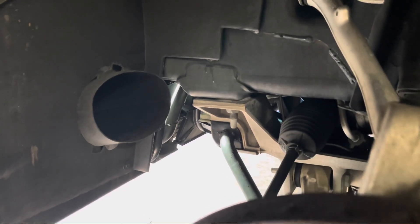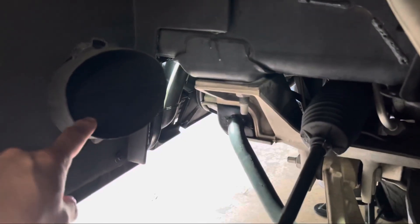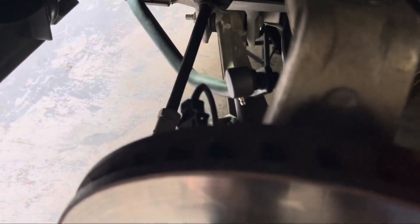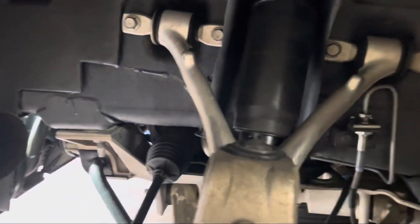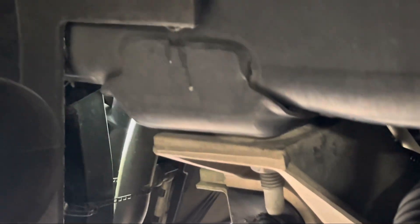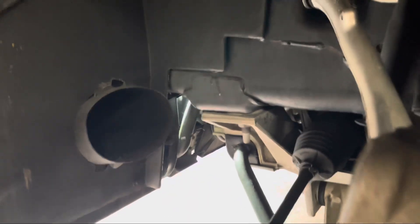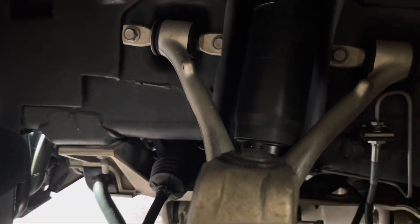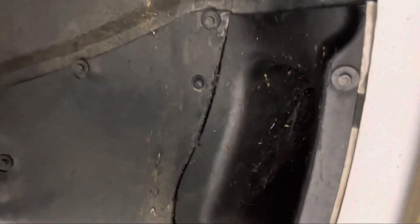Remember we said there's going to be a little problem with all that extra air coming in from the front. Right here we have the brake duct along the front, which draws air in to cool down the rotor assembly while you're under hard braking. That air normally comes in here and gets trapped and spun around. The additional air we're getting in from the front bumper mod is also going to be introduced with the air coming in from the ducting, creating additional pressure against the car.